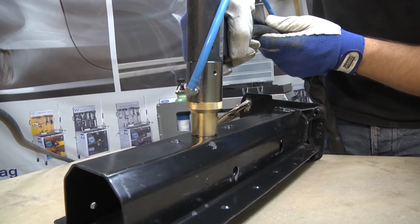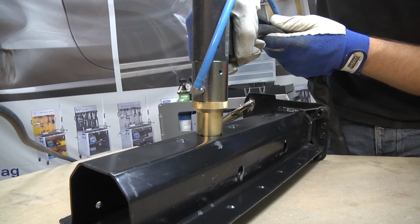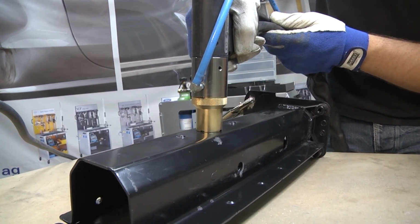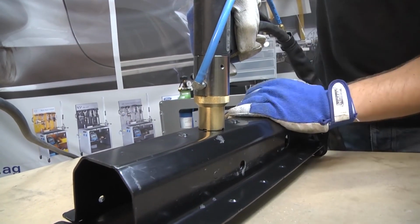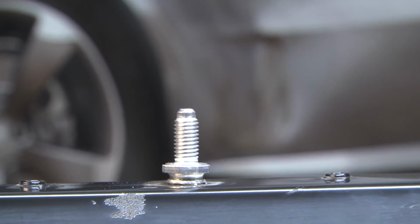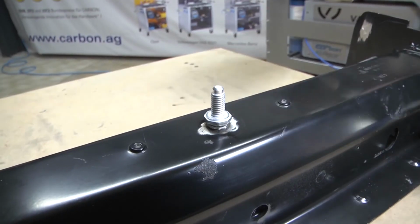In slow motion, you can see the high amount of energy that is required to fix the bolt securely during the process to both thin aluminum sheets and thick-walled cast aluminum parts. The difference between thin aluminum sheets and cast aluminum parts is important to note, since this greatly affects which parameters you select on the power unit. In the picture you can see how the high amount of energy applied to the part has created a neat, secure weld at the base of the ground bolt.